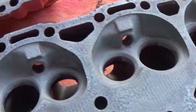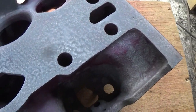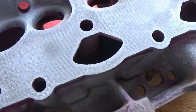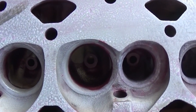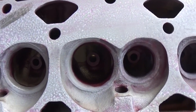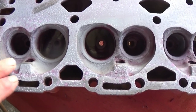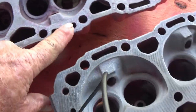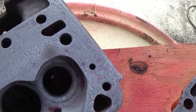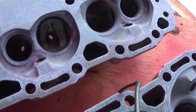But I'm not seeing none of that. I won't say these heads are alright — at least this one anyway. This one, I don't think I got the penetrant off real well, because I'm seeing a little... there's little pink places left all in. I may clean this one up and do it again, just for the sake of knowing. But I'm not seeing anything that would be an issue. Looks fine to me.